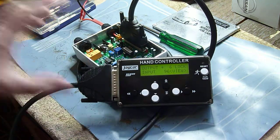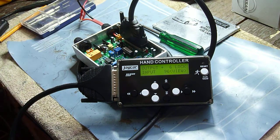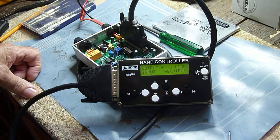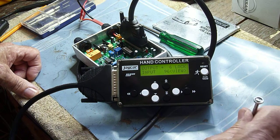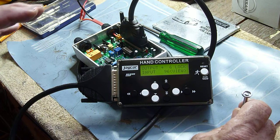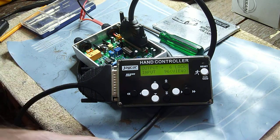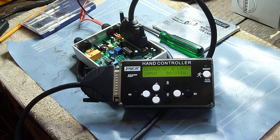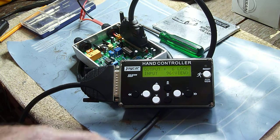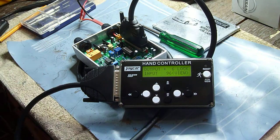On the screen we have input and output. Input is actually the load point and there are about 255 of them. The output is the amount that we're changing the MAP voltage to. That number is derived from whatever voltage spread we're using on the unit, divide that by 255, and that gives us a unit. So that'll be six of those units.